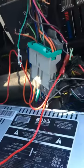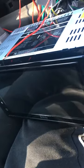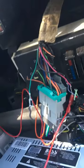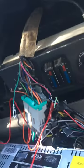They have the volume up on this all the way, but it's not playing. But when I turn it off, everything goes off normally. Easiest way to fix it — put that pink wire with your accessory wire. Everything works like nothing, bro. Easiest way, instead of buying that $40 box to bypass. It's pretty easy.